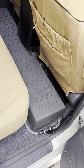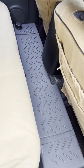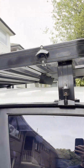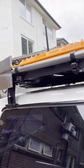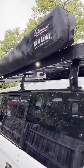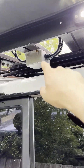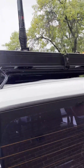In the back there is a 40-litre Boab tank which is plumbed right the way through the back, with an outlet at the back where your fridge and kitchen would normally be. Up at the top is a Front Runner roof rack — a pretty old-style one. I've mounted a shovel, MaxTrax, an antenna, and a decent-sized batwing awning. Up at the back I've got lights mounted up here — one cable comes in which is all remotely controlled with those switches, covering the lamps up top and lights out the back. Just makes it look pretty neat.